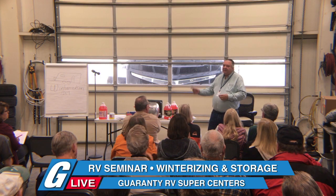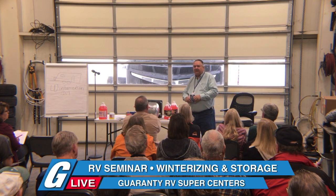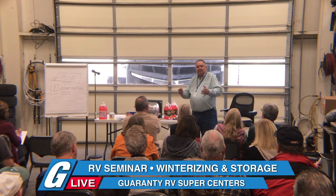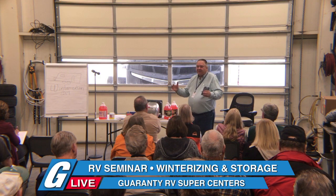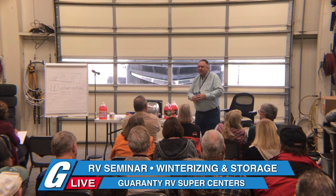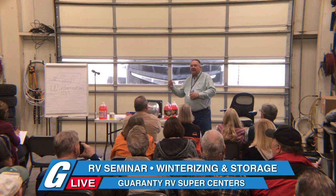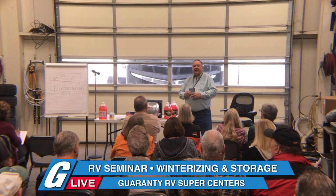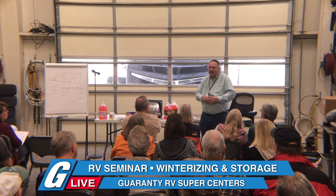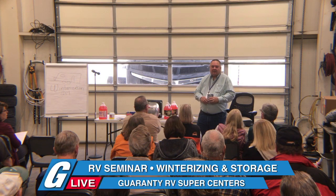If you don't have a winter package on your RV, and most trailers and little fifth wheels do not, a winter package has more insulation, plus they insulate the holding tanks and put heat down into them. So if you have the winter package, you can use your RV just like normal. If you don't have it and it's winterized, you can use the heat, you can cook, but you can't use the plumbing system.